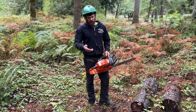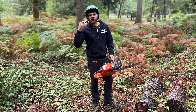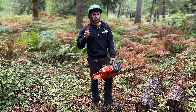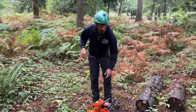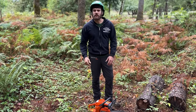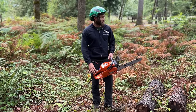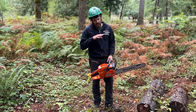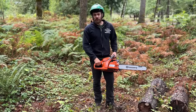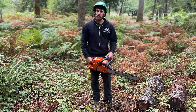Okay, so I've been pulling and it's just not starting. What happens is so much gas is going through that at a certain point you actually flood the saw. I don't really know what that means, but I know how to fix it. There are really only two ways if your saw is flooded. One is just put the saw down and come back in like a half hour or something to let the gas that's in there dry out and then start again. But if you flood the saw and you need to get it going, the only other way that I know how to start it, and this is not textbook or anything, is to hold the trigger down. I don't know why it works, but it works. If you hold the trigger down when you start the saw, it will fire up when it's flooded.